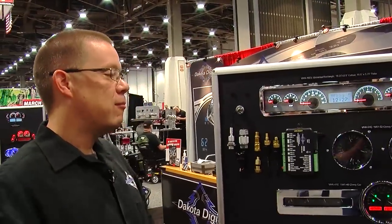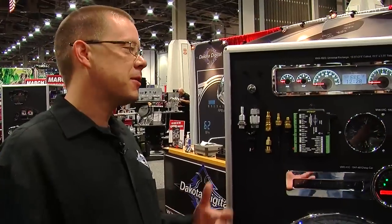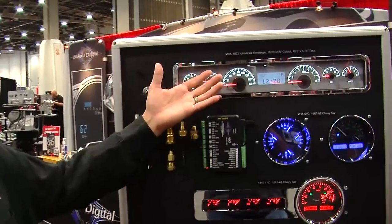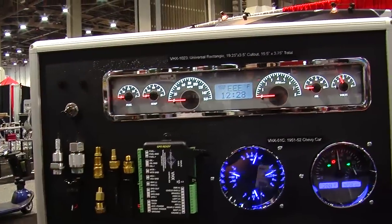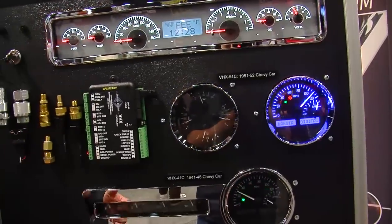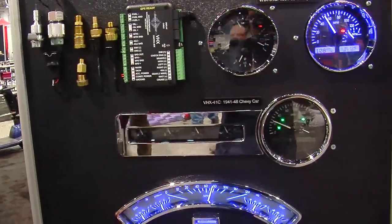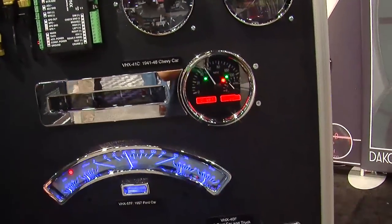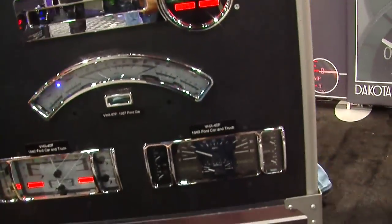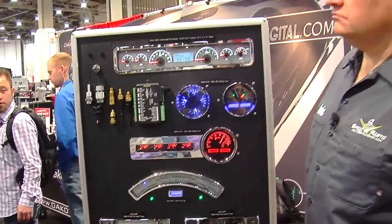Number two, you have more readouts. You're going to generally add a tachometer, a clock, and backlighting. So viewability, not only at night, but during the day, is going to be good. The needles are lit. We have electronic solid state sensors, so the accuracy, of course, is phenomenal. There are many advantages, but compatibility with a modern drivetrain usually is step number one to getting somebody to think about it, or just looking more modern more than anything else.